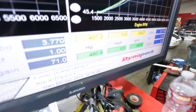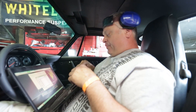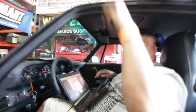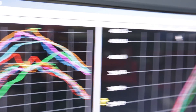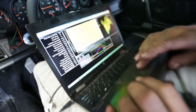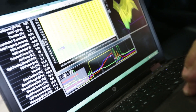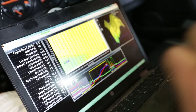That's 480 horsepower — pretty damn good — and 465 foot-pounds, so it's coming up. The clutch is starting to slip right at 5,200 rpm. You can see it on the dyno: the line should be 100 percent linear when everything's working right. That little hump is the clutch slipping — it's not getting smoked, just over-running a little bit, which is probably breaking it in aggressively and quickly.